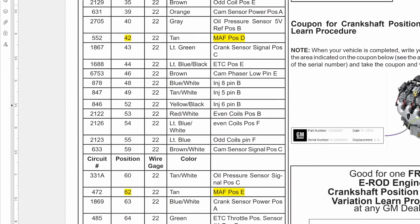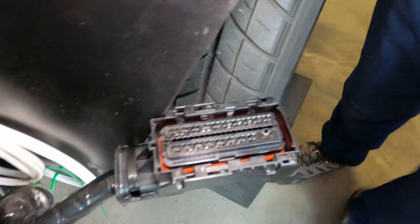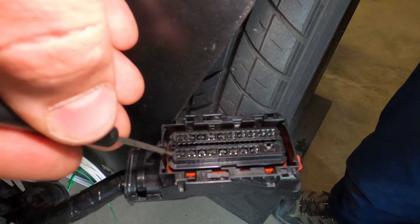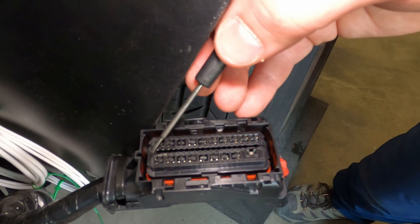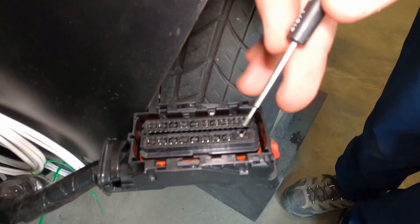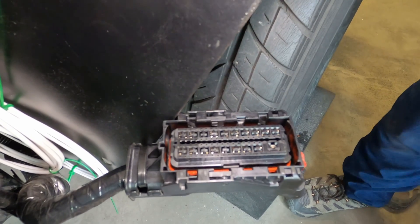To check those connections, you need to understand how the ECM's connector pins are numbered, so here's Dylan explaining it. This is the middle connector on the engine computer — the connector that goes here. This connector is known as item C2; it's the black connector. We believe that this is pin number 72, and that would make this pin down here pin 1. It counts along these rows: 1 through 16, 17 through 32, 33 through 52, and then 53 through 72. Pin 53 is labeled on this connector in the top left corner.